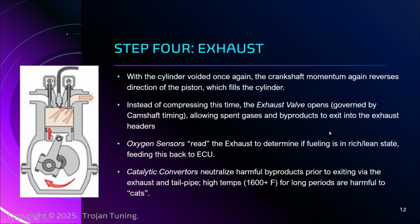And the catalytic converter is an interesting aspect to this whole thing, because I'll present two sides to it. When you're sending these byproducts out, they hit the catalytic converter, they're incredibly hot, and the catalytic converter itself, by design, heats up. It's meant to handle these high temperatures. As the hydrocarbons enter it, and these are the kind that pollute the environment and contribute significantly to global warming, the catalytic converter scrubs them. That's catalysis, I guess what you call it. Catalytic means I'm turning it from one thing into another. Transmogrifying, if you want to be mystical about it. It takes the nasty, smelly hydrocarbons that pollute the environment and converts them to a form that is not as harmful, not as smelly. That's the good part about this thing.